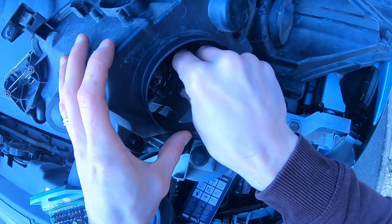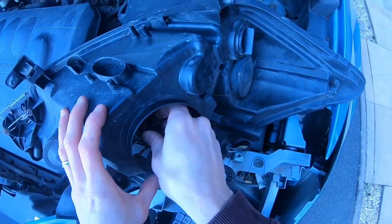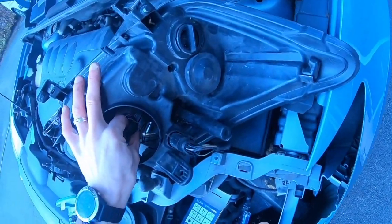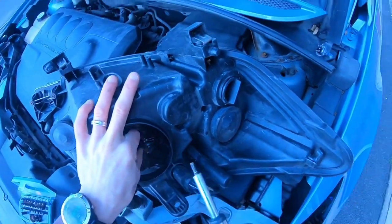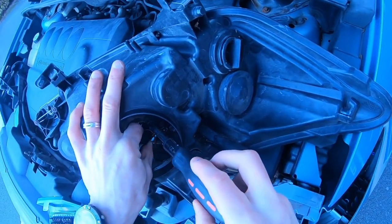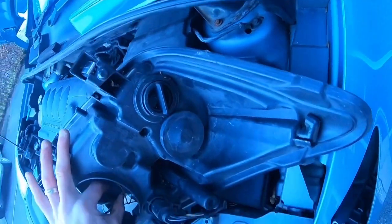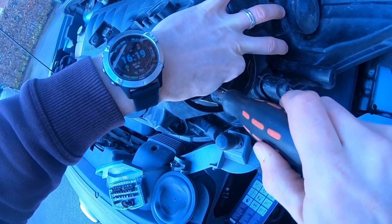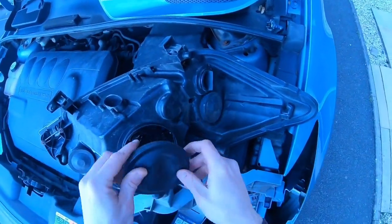Put the housing back in, and this time you're going to rotate clockwise. So turn it clockwise, and then get your screwdriver again, tighten up them 2 little screws. Right. There's one, keep holding it. Access your second one, make sure it hasn't moved. Not too tight, just nip it shut. Don't forget your rubber cover.